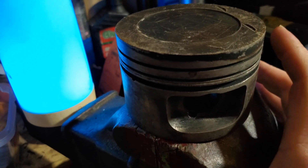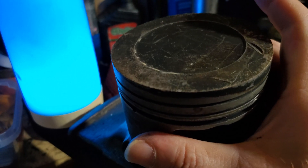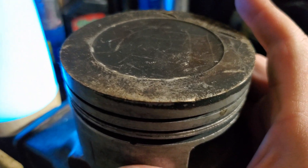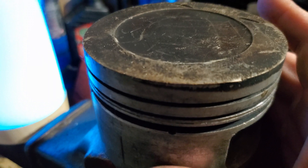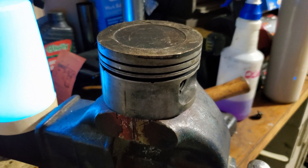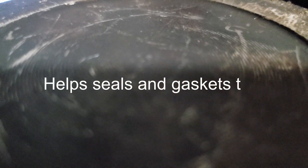Because if you have a vacuum drawn out, those rings will expand and they'll seal a little bit better and tighter from the piston to the cylinder wall of the block. And this has been proven by a number of dynos that you can search. I remember working at Alamo Motorsports and we had a little one-liter motor we put on the dyno that had a dry sump oil system. When you took the oil cap off that system and dynoed that car, it lost three horsepower at the tires every time. Put the cap back on, it gained three to five horsepower every time. So crankcase ventilation is very important.